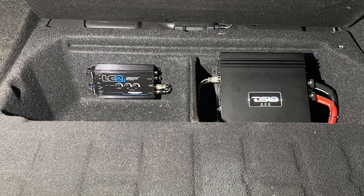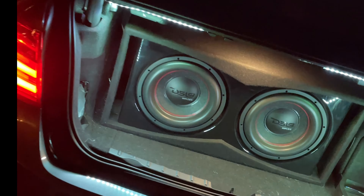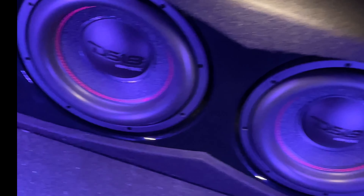We got one set of wires going to the blue/red and the blue/brown — that's going to go to one sub. And we have another set of wires, the black/red and the black/brown, going to another sub. That's where I got my channel one and channel two inputs from. As far as the power goes, I had this real thin black wire we used for the remote wire — cuts off about 10 seconds after the car's on standby. The red wire is our main power wire, and the brown wire of the harness is our ground.